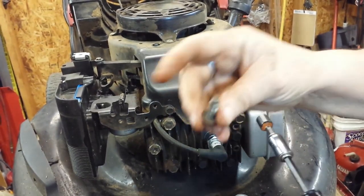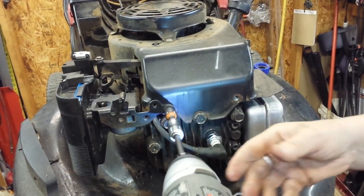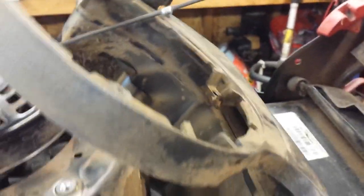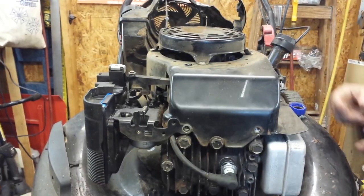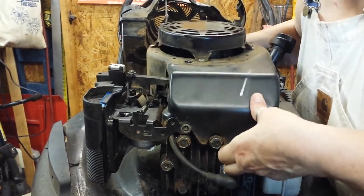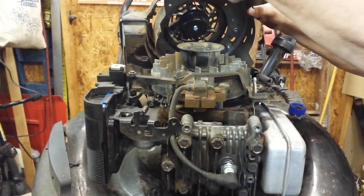These are some longer bolts; the ones in the back are shorter. As you can see these bolts are shorter. So we're ready to pull that metal shroud off. It's a little tight getting it off — it sometimes gets caught right there, you just have to kind of wiggle it off. And so there's the recoil starter completely free.